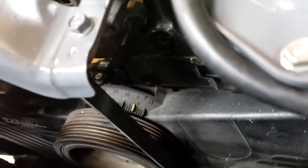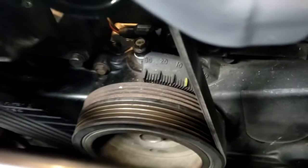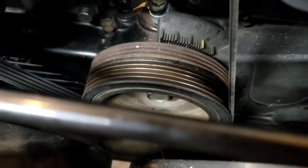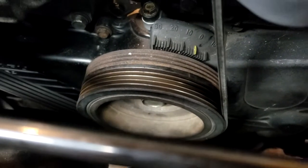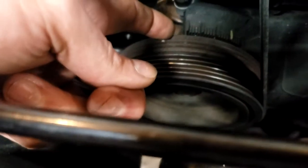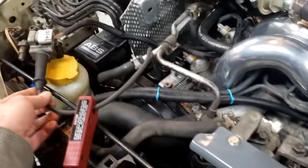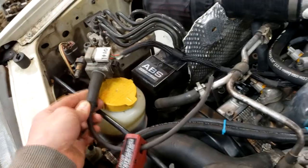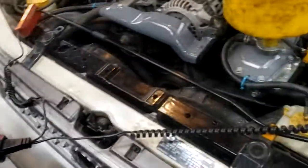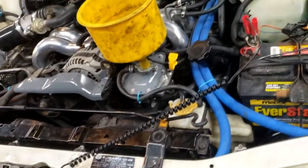First time using a timing light on those little marks right there — basically just put a paint mark on zero. The mark is actually on the back side, there's a little tiny groove on the back side of the crank pulley. I took a 25D spark plug wire, shoved it on instead of the boot on the coil for cylinder one, plugged that into the cylinder head, and then used our timing light. And turned off injectors on the ECU and locked the timing.